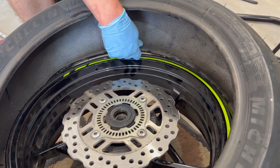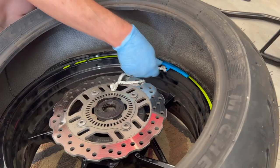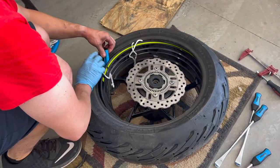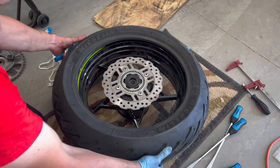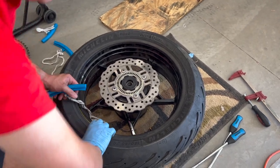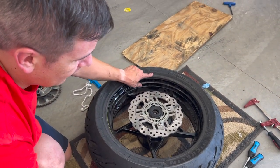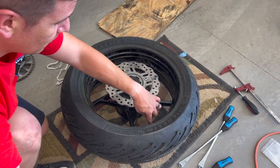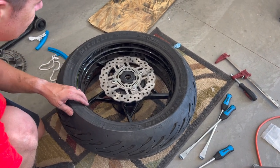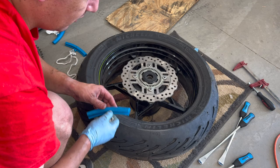Of course there's always going to be something — there are some strings here that are just getting in the way. Now we've got to get this side of the tire on the rim, which should be relatively easy. Sometimes tires are labeled with a white mark showing the heaviest or lightest part of the tire, so you know where to mount it relative to the valve. This one doesn't seem to have that marking, so we're just going to proceed with putting it on and balance it anyway.